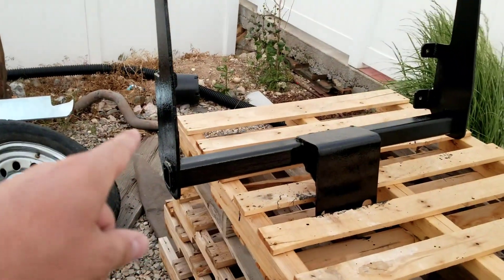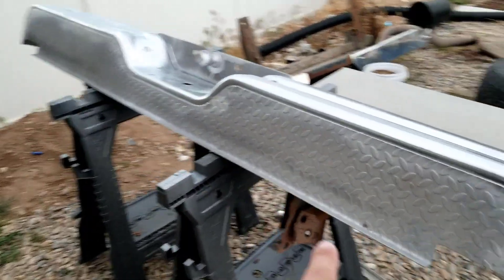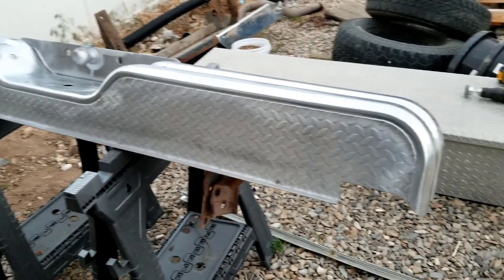If you haven't seen the video of me doing chassis saver on the truck, I'll link it in the description. That stuff is not very UV resistant, so the reason I'm okay doing it on the frame and on the hitch is all that stuff is tucked underneath the bed — it's not going to get a lot of sunlight on it. But I'm not going to use chassis saver on top of the bumper because it's going to be in the heat of the sun most of the time — I'm going to use bed liner there instead. You just have to know the product, know its strengths and weaknesses, and use it accordingly.